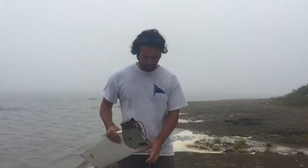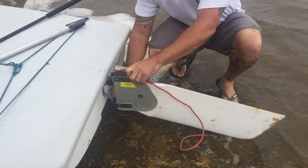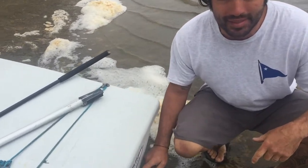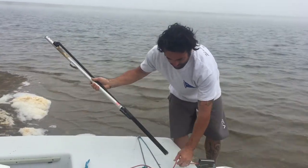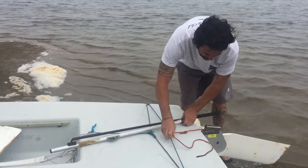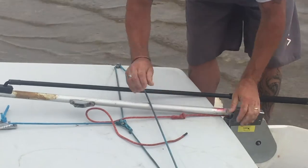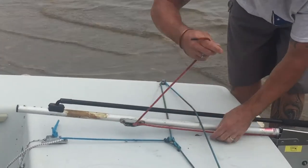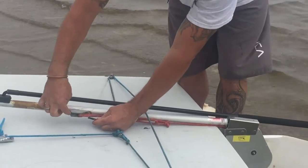Next is the rudder. The laser does have a tilt-up rudder — it's a little fussy to set up. The rudder goes into these gudgeons and this little locking tab keeps it from falling out. Before I forget — don't forget the plug. There's a plug in the back to drain any water that gets inside the boat. Make sure it's in, because otherwise you'll sink. The tiller and tiller extension go through the traveler hole here. This line that attaches to the rudder slides into this little groove. We'll go through the clam cleat, and when we lower this down we'll push it back through a second time and cleat it. Then it's ready to go.